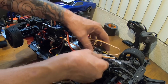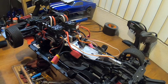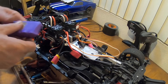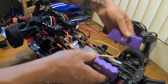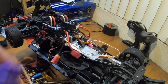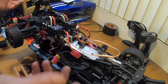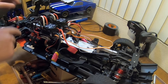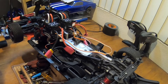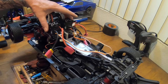Not sure where I'm going to put the receiver or antenna yet, so I just have it set there. The last soldering I have to do is the cap packs — I'll put bullets on here to plug them in, but I won't need that for testing since there won't be a big load. I want to make sure the timing to both motors is good, then I'll plug in my Castle Link and calibrate both ESCs to the settings I want.